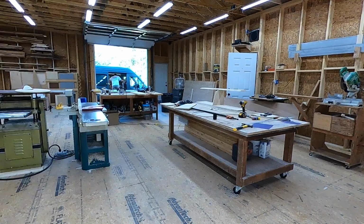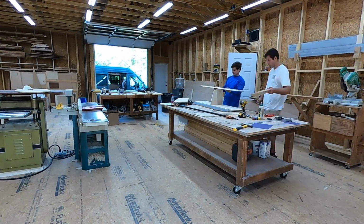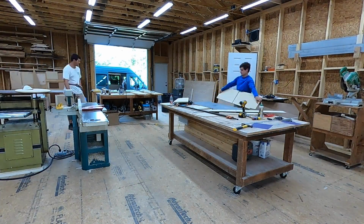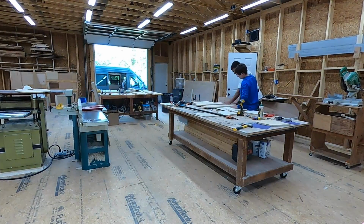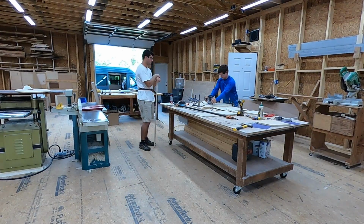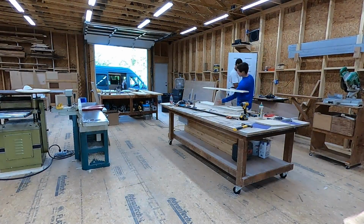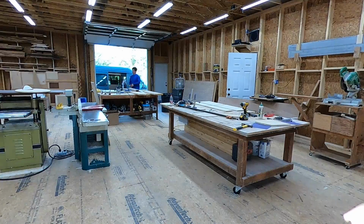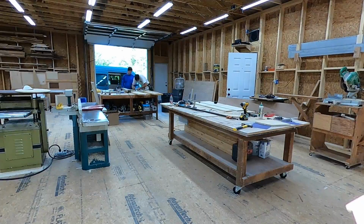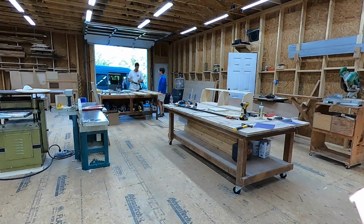And one thing about the cabinet that goes above the kitchen is it has some weird contours in it because it goes right next to the sliding door, and so the metal that holds the door frame basically sticks out away from the wall, and so we had to take a lot of time and make a template and figure out exactly where we needed to cut the cabinet, and we actually cut a big chunk out of the rear right corner of it to where it fits around the metal for the door opening. And that's why anything you do in a van is going to take exponentially longer than anything you do in a house, because everything is custom.